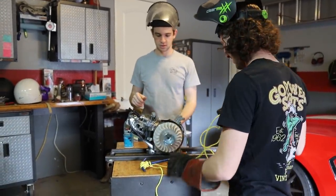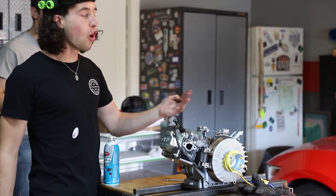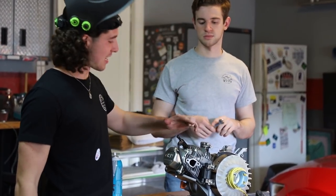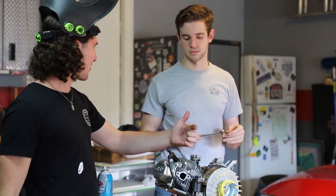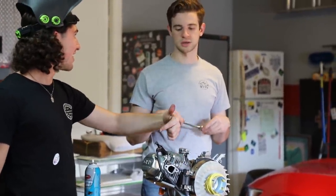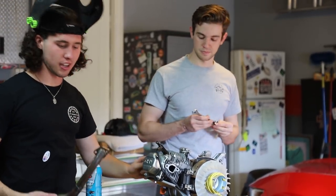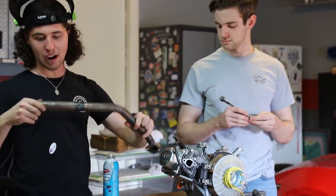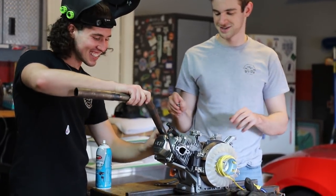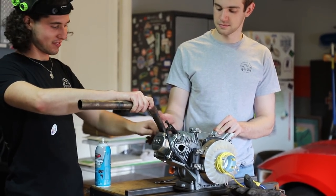I agree. Okay, so instead of spraying the starter fluid, oh, you know what? I bet what happened is the starter fluid was in the same range as the exhaust. So I bet it sparked from over here. Oh, right? Maybe. That's very likely. So anyways, to avoid that, we're just gonna put this Gopowersports FMV header pipe on there, link in the description. And we'll be able to inject starter fluid into here.